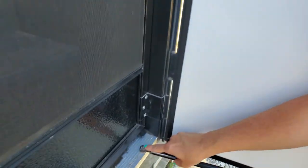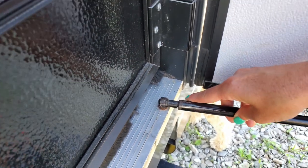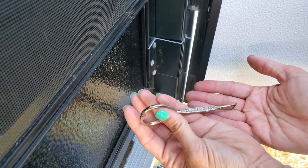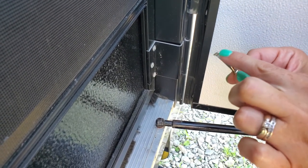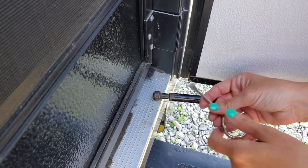First thing we have to do is take it off. I looked at Brian and said there's no way to get this off, and he said he had an idea. Basically there's a metal ring on the gas prop and you have to get that off before the prop will come off. We found a handy little tool — some of you might recognize it — this is just the tool you use to open a can of paint. See how it has a little curve to it? That's perfect for getting right up under the metal ring and popping this piece off.